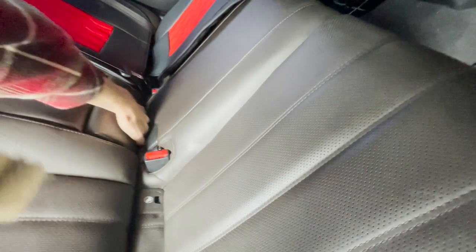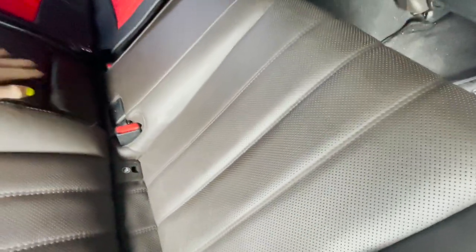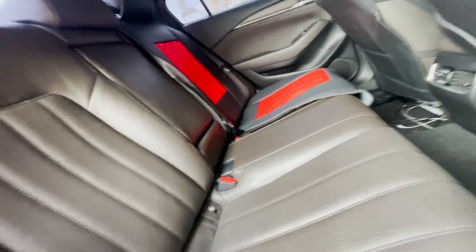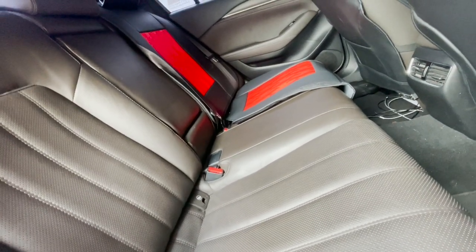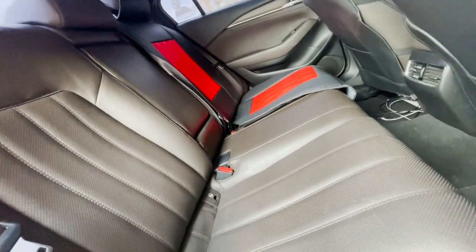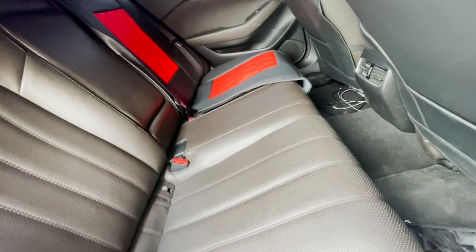For the rear seat you're going to want to lift up the seat bottom. Slide your fingers under here until you feel a little lever — it's like right under the third little stitching, and it's on both sides. Push it to the left and that'll unlock the seat, then there's another one right in here — push that one too to unlock. Then you should be able to take it all off. Honestly I didn't unlock the third one because I don't want to take my seat bottom off — I feel like I'd break it.